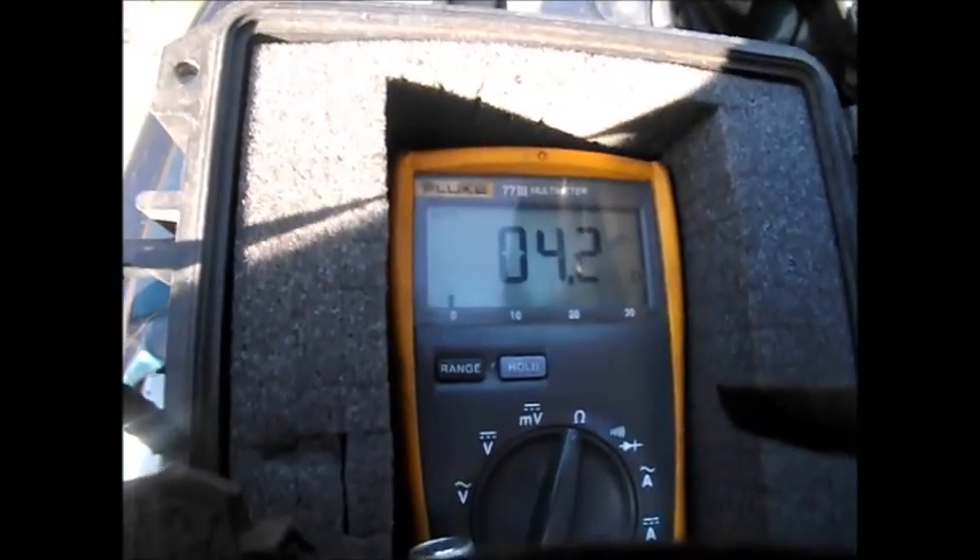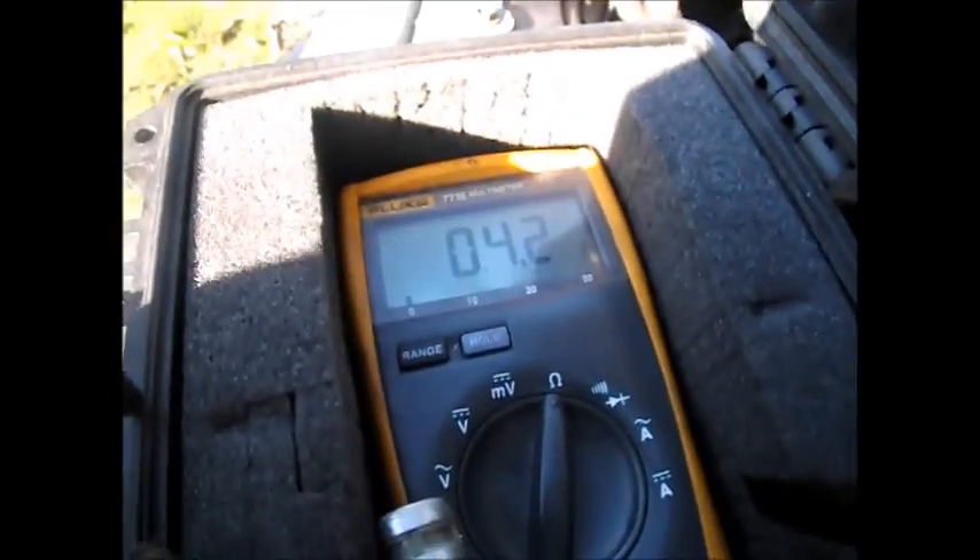I'm going to guess maybe the connection isn't so good to the solenoid. Running some power through it — let's use the diode test mode. My multimeter says the solenoid is working fine electrically, but maybe it's got a dodgy connection somewhere. Maybe someone already replaced the solenoid — I don't think so, because it does the things it would do if it were chowdered.